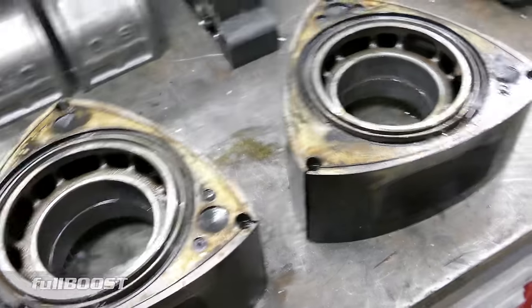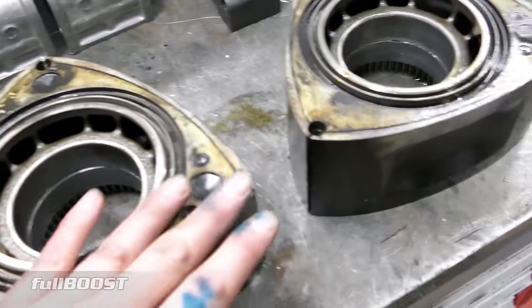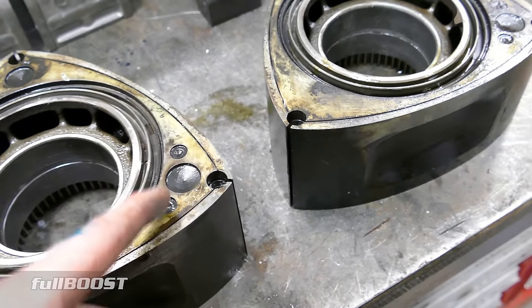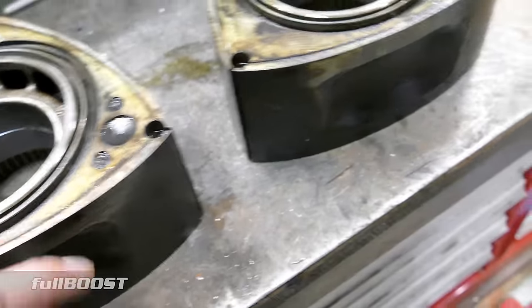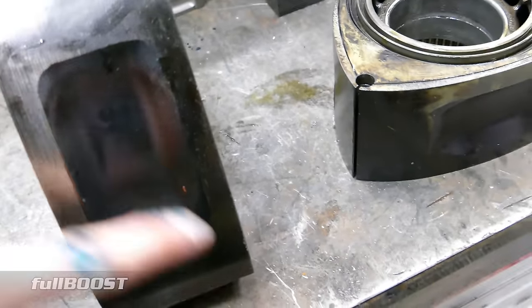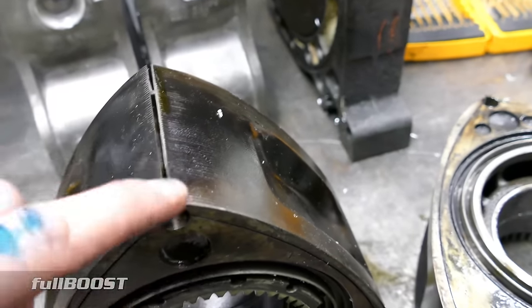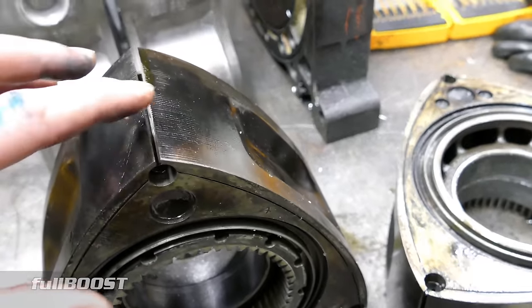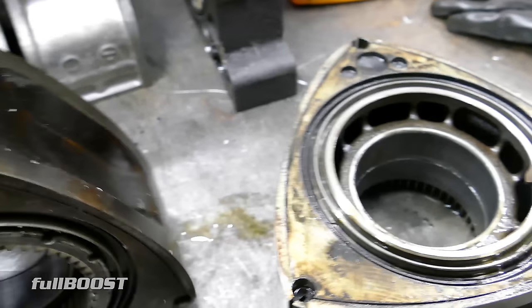The next step is the rotors. When it comes to racing engine preparation, we want clearance in certain areas. Pretty much off the entire surface of this face we're going to remove a very, very small amount. Then in the corners of the tips here, we're going to remove another small amount. Across this edge here and across the face between the combustion chamber pocket, we're going to remove a certain amount, and also across the top of the apex seal tip of the rotor we'll remove a small amount as well. The reason is that at extreme high RPM, these areas are prone to contacting the housing surface.